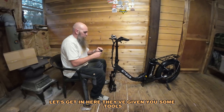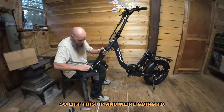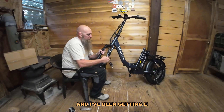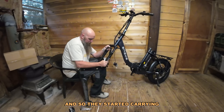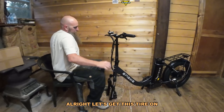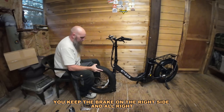They give you some tools — these are kind of throwaway tools, not something you'd probably want to keep, but it'll get the job done. We are going to take this little bracket off. Back in the day they didn't put these brackets on, and I've been getting e-bikes with broken forks right at the triple tree. So they started putting this bracket on here and that's eliminated that problem completely. Let's get this tire on, then we'll put the fender on. Make sure you keep the brake on the right side.